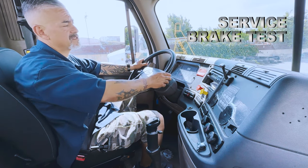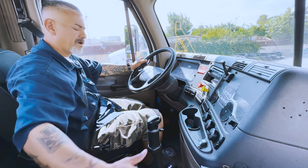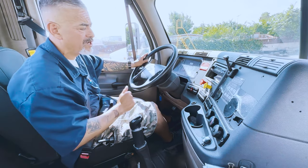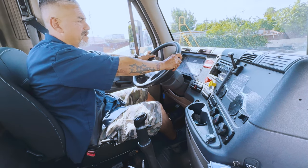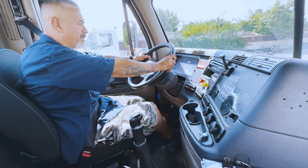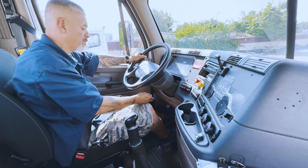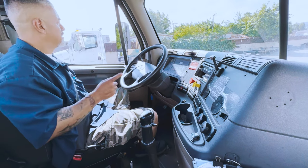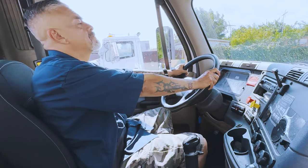Next is my service brake test. I'm going to pull forward no higher than five miles per hour — no one should be standing on my left or right for safety. Put it in clutch and put it in first gear. Step on your brake lightly so the truck doesn't roll back when you release both brakes. Once you start releasing the clutch, start releasing your foot off the brake and pull forward. Put the clutch in when you stop and stop with your service brake. Let the examiner know my service brakes hold, my truck came to a stop. Pull your brakes out, go to neutral, get your foot off the clutch and brake. Tell the examiner this is a good test because my tractor didn't pull to the left or to the right. This completes my final brake check.